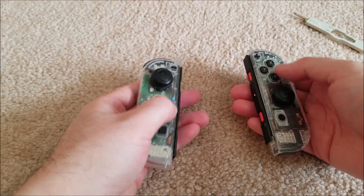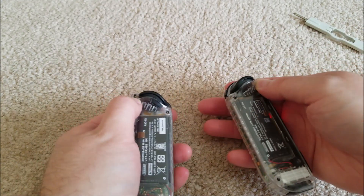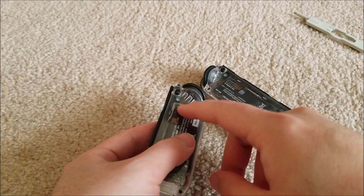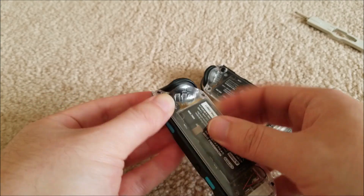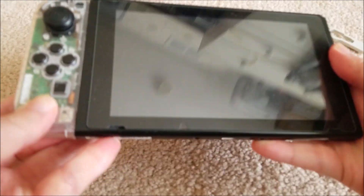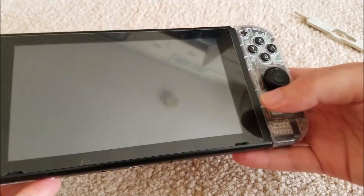Okay, we're all back together - all the buttons still feel okay. One thing to note: the original plastic might be just slightly thinner in terms of height, so I couldn't screw that silver metal bracket over the latch very tightly, otherwise the button doesn't pop up and gets stuck on the metal. That's something to be careful of - you have to test fit it. Let's slide these on and see how they feel. Oh yeah - it's nicer! There's still a little bit of wiggle but not nearly as much as before on that one, and this one is still solid.